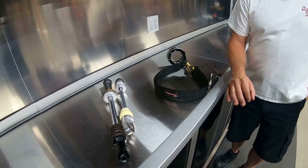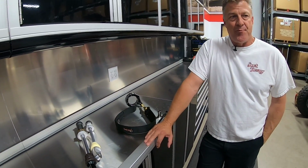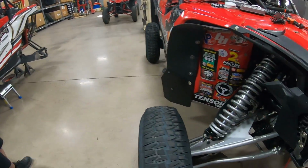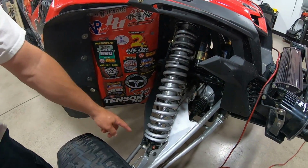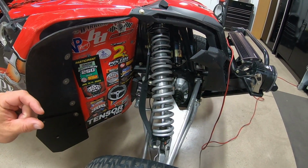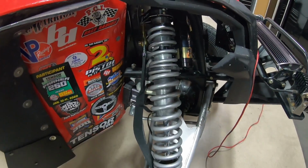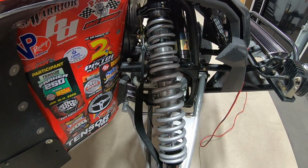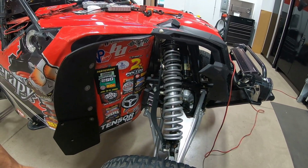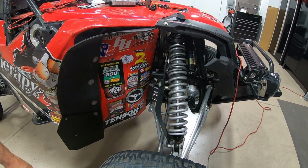One more here, sorry, from ELP Square. Will it affect the articulation? Absolutely not. Straps don't affect any overall travel. There is no restriction other than the length of the strap. And again, if it's adjustable like ours is, you can tighten up that system to within 1/4 of an inch. Keep it 1/4 of an inch from fully extended. So you're losing no articulation, you're losing no travel worth worrying about either.